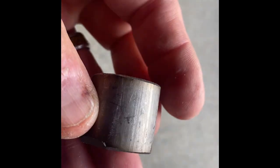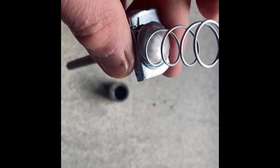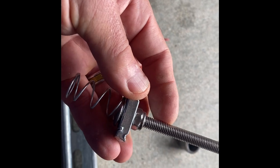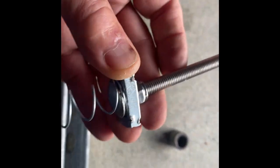This is a bit of marine-grade tube that I had lying around and I've just cut it down to the right size. I've knocked a couple of flat edges on it so that when I put it on it'll sit nicely against the beveled edge of the unistrut. The M8 bolts that came with the step aren't long enough to accommodate the additional space, so I've also got some M8 stainless steel coach bolts which I've simply trimmed down and bolted through the M10 unistrut bolt retainers. If you're doing this from scratch, just get M8 unistrut fittings rather than M10, but I've already got these so these are the ones I'm going to use.